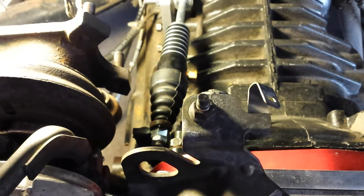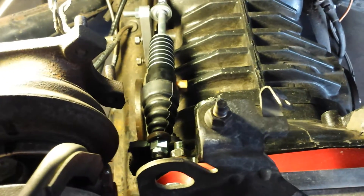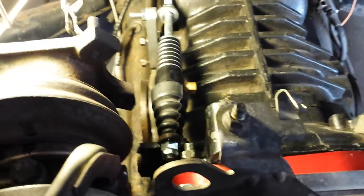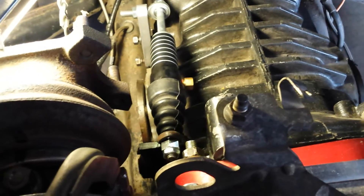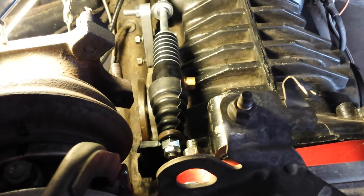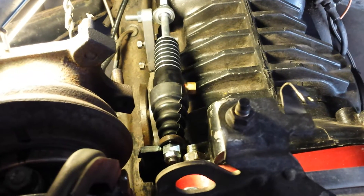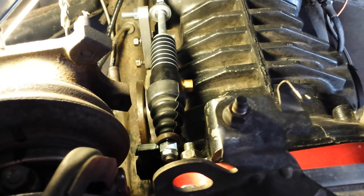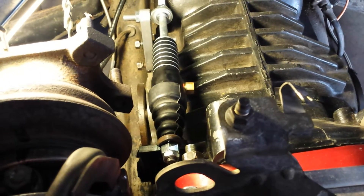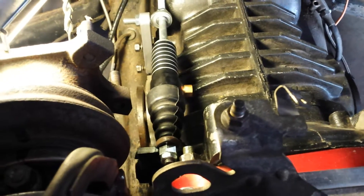The engine was in and out like five times. I hope that'll hold — I'm kind of worried about the twisting force this way, because I'm running a stage four pressure plate, which is ridiculous. It's probably the strongest one you can get. I'm planning on running that much torque and power through this so I need the strongest one I can get. According to Kennedy's website, they said 298 foot-pounds of torque with an organic disc is the stage four. We might hit that, might not — I could be thinking we're going to be pushing a lot more power than we are. But what the heck, may as well get a good clutch in there, good strong pressure plate.